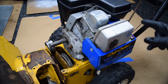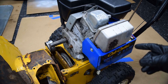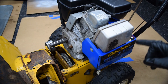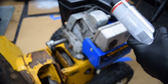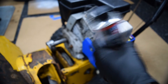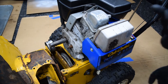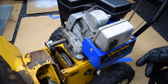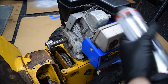Before stripping it down, I'll go through basic maintenance. When I got this the oil was tar black — you could not see through it — so I put some Marvel in it and let it run. I also had to drop the fuel bowl and do a quick carb clean because it wouldn't run. I let it run for five or ten minutes to warm up, then changed the oil and added a zinc additive. Most small engines are flat tappet, so a little extra zinc protection is worthwhile.